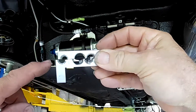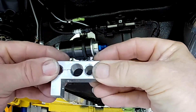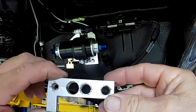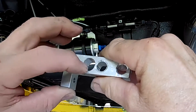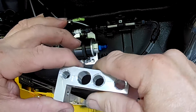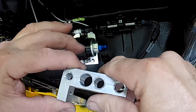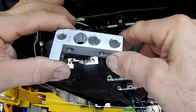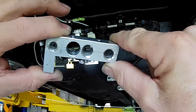I've got one of those set up in the lathe at the moment, so I'll take you over there for a look at the process of boring one of these out. I'm doing it on the mini lathe rather than the drill mill because I don't have the right-size end mill, whereas I can set it up on the lathe. It's a bit of a dodgy setup — I'm running the lathe really slow and being really careful. As always here on the Aussie Shed, don't do what I do — I'm just an idiot, just be safe.